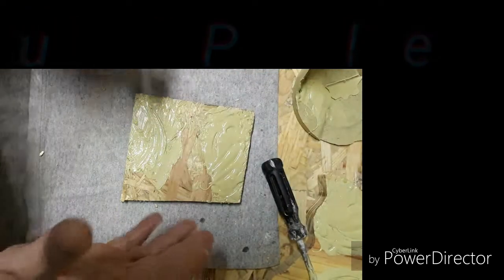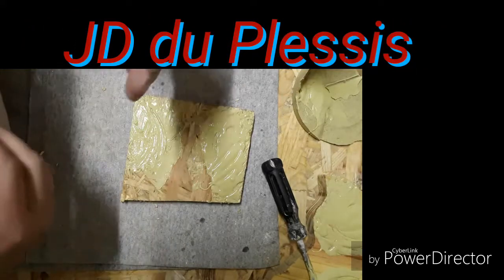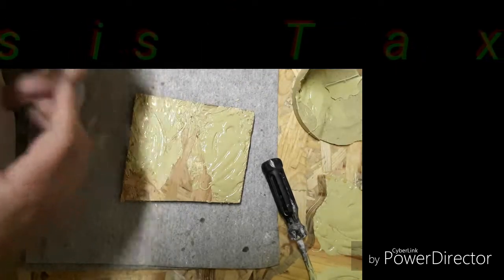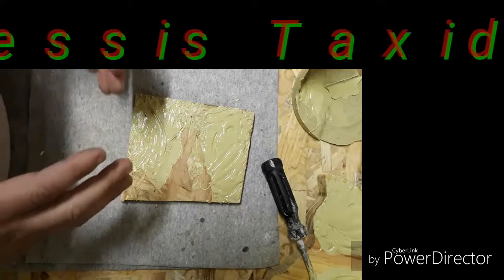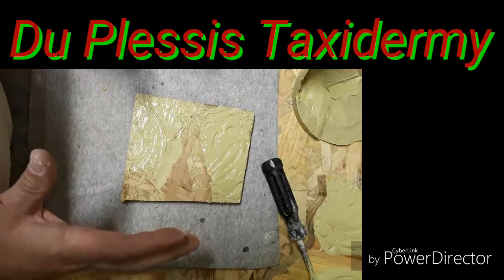When using sandpaper, stick with a rough edge one. Start with 60 to 80, 100, 120, move up to 300, then a 500, 600, 1000, and 1200. 1200 and 1000, that's basically for polishing and smoothing off. The 60 to 500 is to sand off the rough edges.